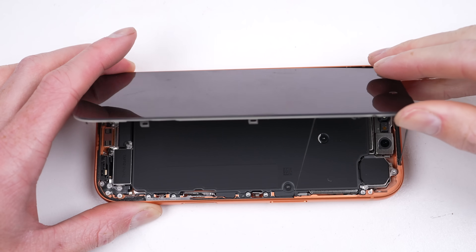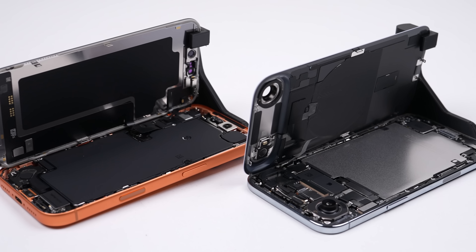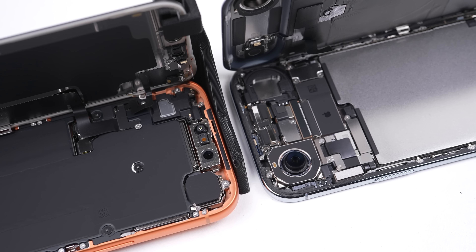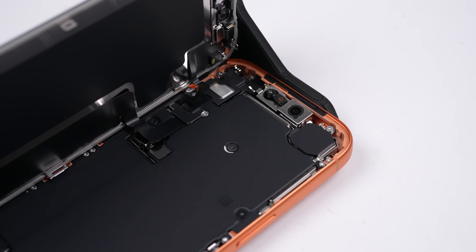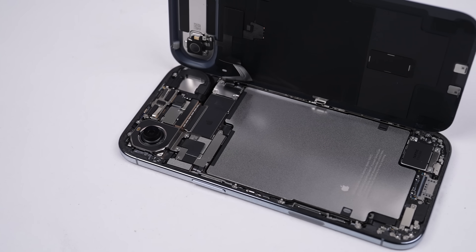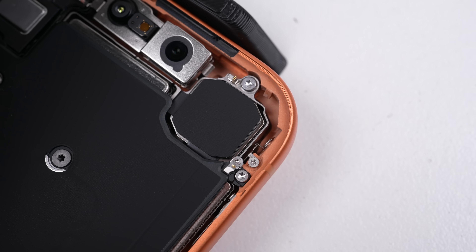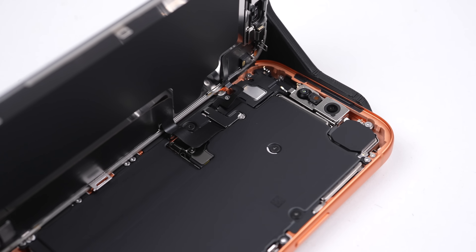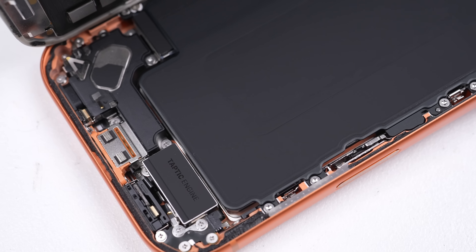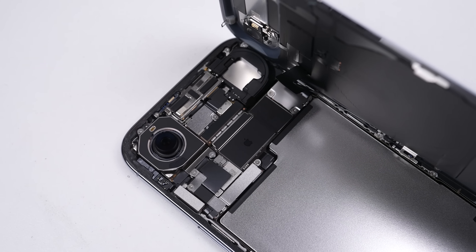Lifting the display to the left hand side, we can see the redesigned internals. Immediately we can see the Pro and Air models are vastly different — not only do they open from opposite sides, but the Pro appears to be covered in a new bracket spanning a large portion of the device, and the Air's battery is enclosed in a metal case. The 17 Pro also features a new type of screw: Torx. Granted it's not a security version, it adds to the amount of screwdrivers you'll need to repair this device, which includes pentalobe, tri-wing, Torx, Phillips and standoff. The Air, however, lacks any Torx screws.